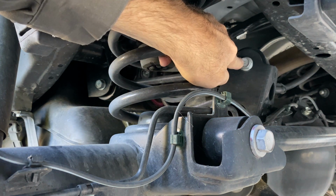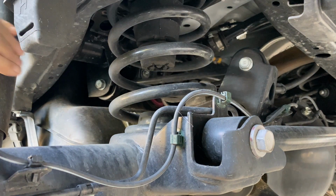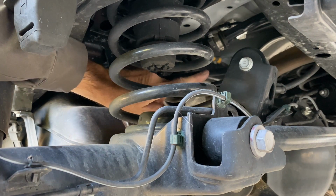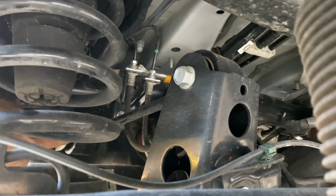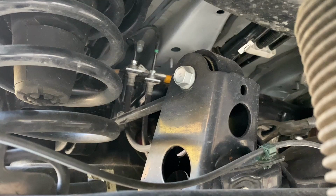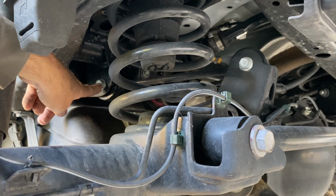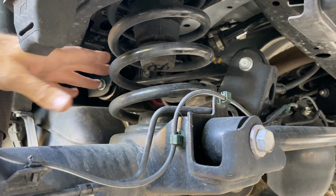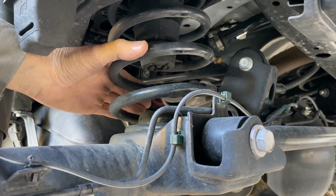This silver bolt here is one end of that missing upper link. We saw the prominent lower link. The upper link goes from there, a bracket on the upper reaches of the axle, to a position here on the frame above the gas tank. That's what this is here. It's running behind, as you can see, the coil spring.